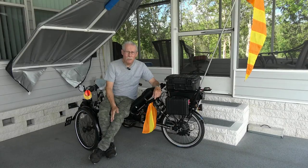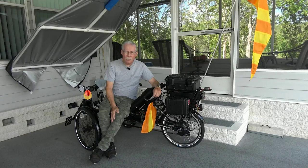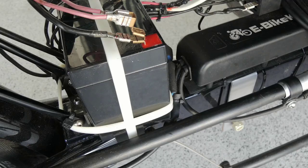Now let's talk about my custom electrical system. I have many items that need battery power and I wanted to eliminate changing small batteries and taking them out to charge. So I added a 12-volt battery. This sealed 12-volt battery supplies power to all the battery-operated extras that consume between 3 and 12 volts DC, and it even supplies charging power to some of them as well. It is zip-tied here on the frame behind the seat, and I use a trickle charger with alligator clips to charge it. Note the e-bike controller mounted on the frame just in front of the battery.